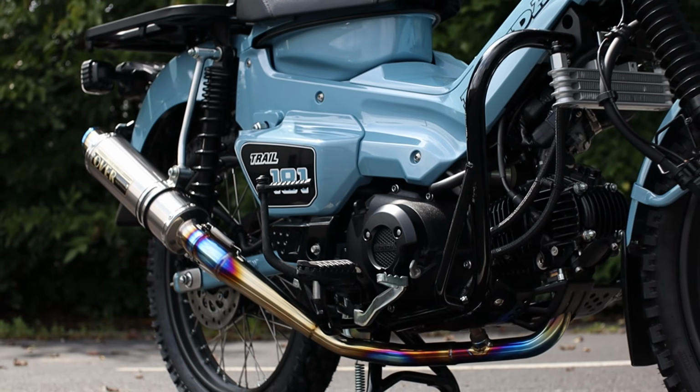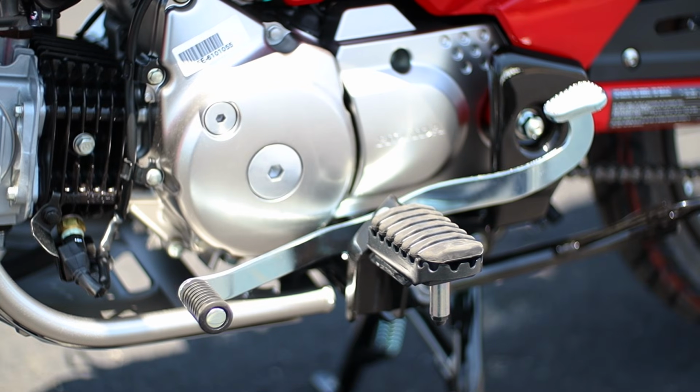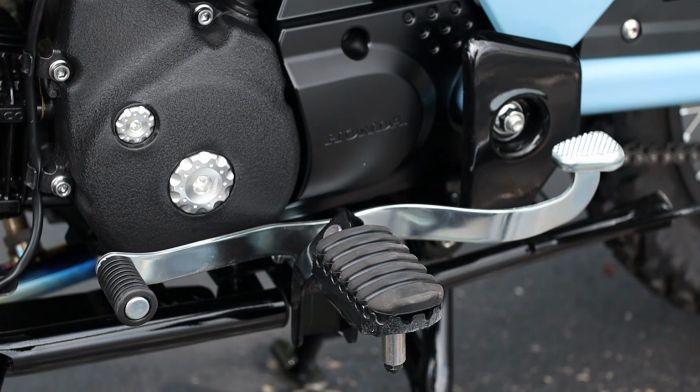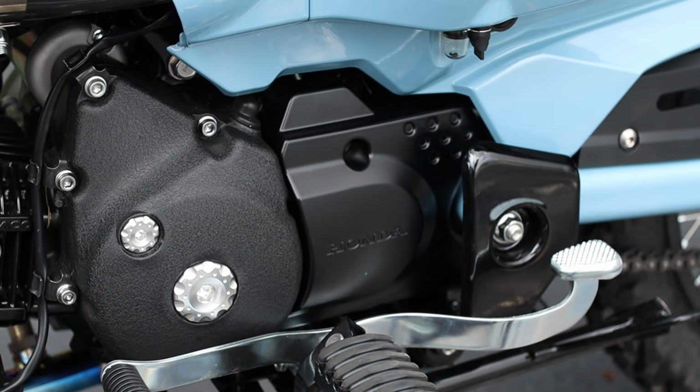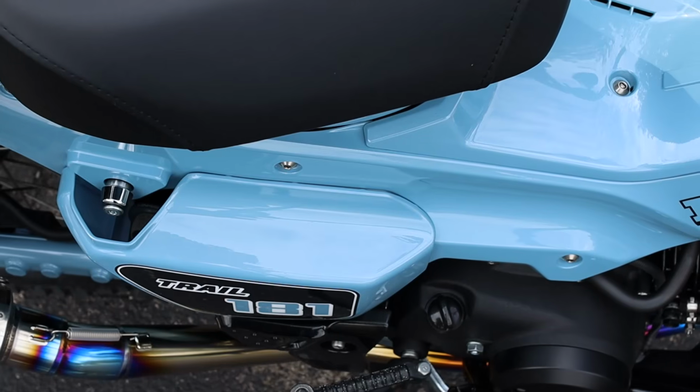Now, are we really going to make all of this extra horsepower in a CT125 and stick with the stock 4-speed transmission? No. The CT is sporting the Takegawa 5-speed, with the first gear being a little taller now, while second through fourth are a bit shorter, and fifth comes in to match the stock fourth gear.